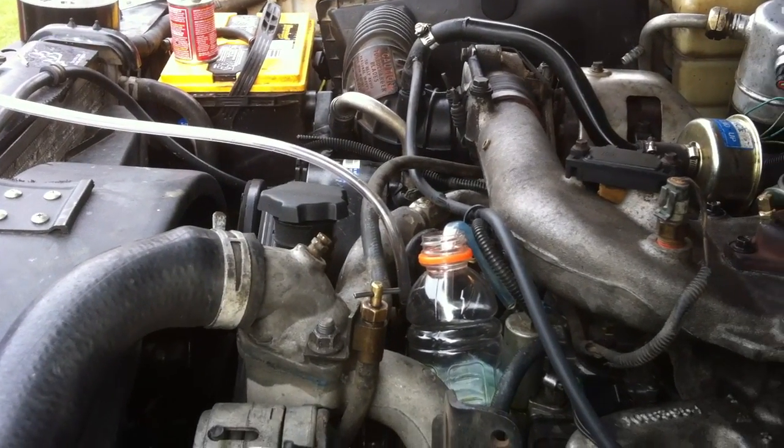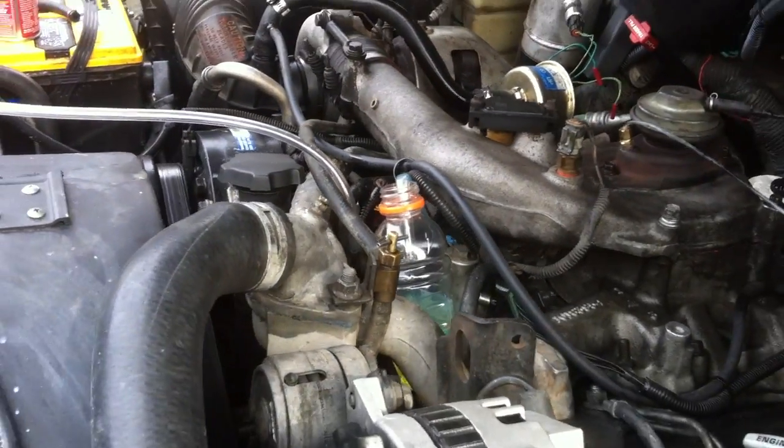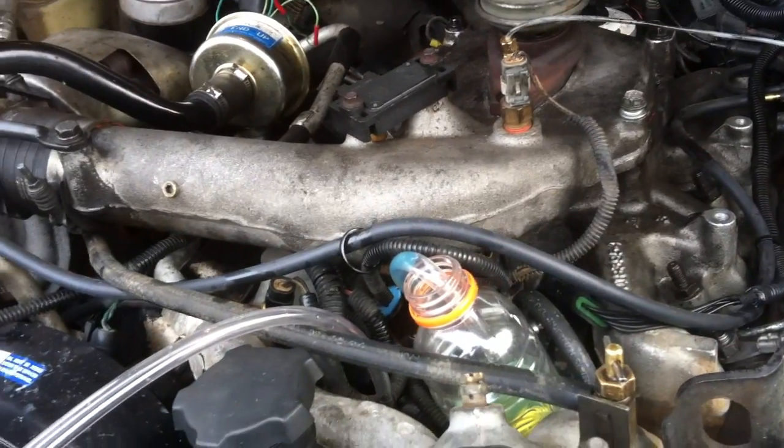Normally the T-valve is where the water collects and you vent the water off out of the fuel. But I'm getting a lot of air in the line and I'm getting intermittent stalling problems. So I decided to do a check on this part of the system here.